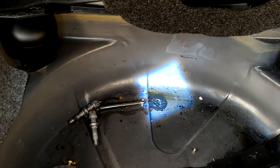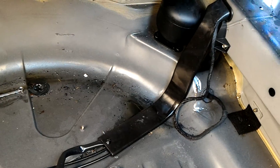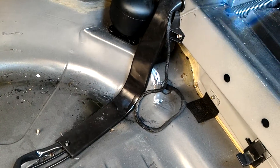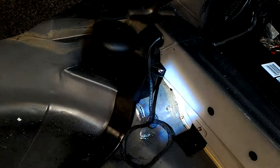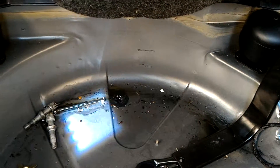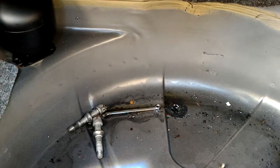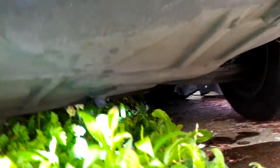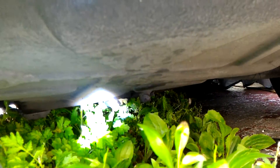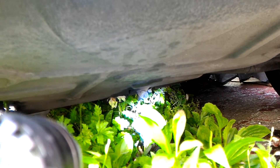There is another drain over here in the center. You can also have a little fluid coming out in between the frame here, entering the spare wheel area and draining out from the center as well. As you can see, it's wet down in there as well. So that's obviously from the cylinder or from spilling fluid when you fill it up. It's a little wet on this little spigot right there, not as much though. I see it's dripping a bit actually.